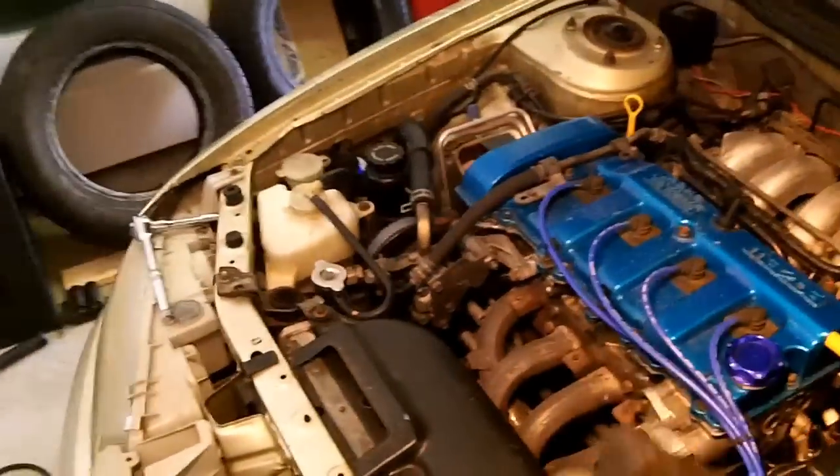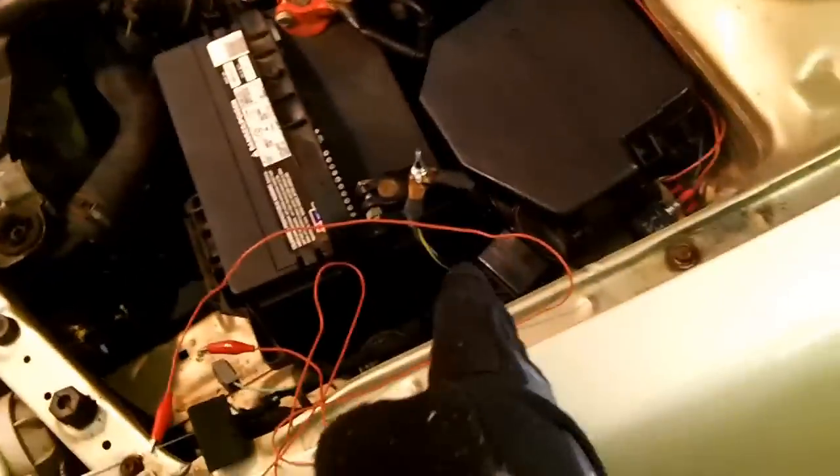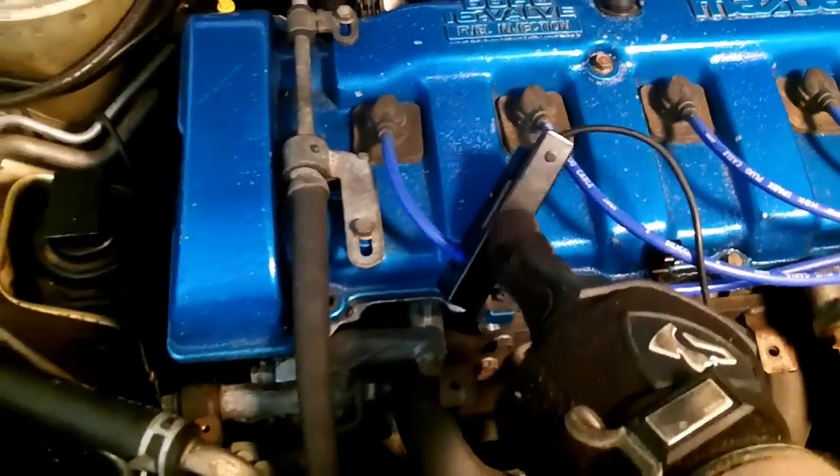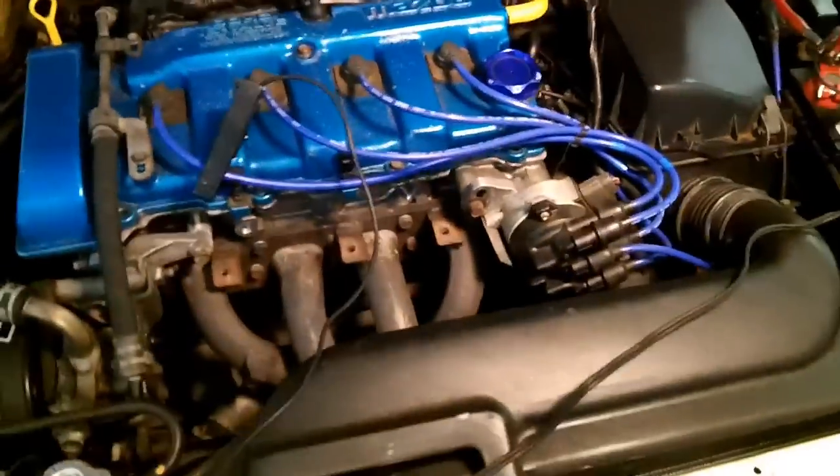Now we've got the jumpers hooked up and we're in diagnostic mode. We need to get the car back up to operating temperature again in diagnostic mode. That timing mark is way over there — it's not even showing up anywhere close to where it's supposed to be. I am way off. Because the timing light is sitting on the valve cover and it's metal, it's going to get really hot real quick, so you want to try and do this quickly.